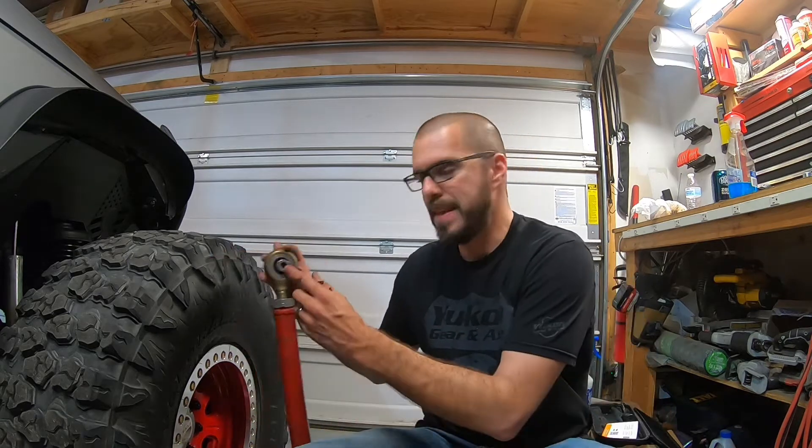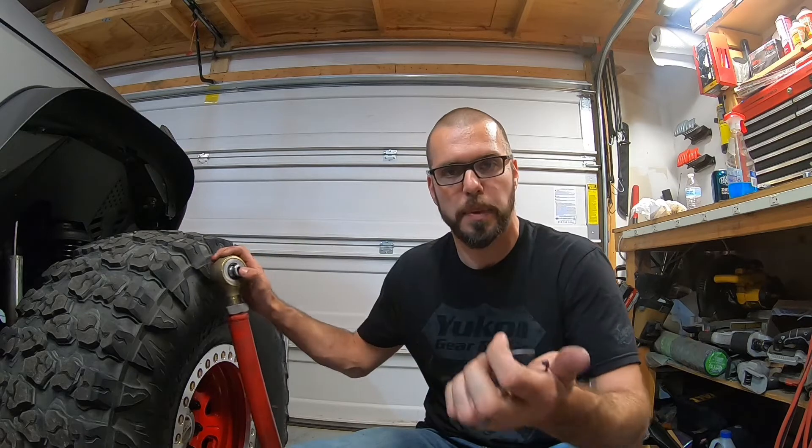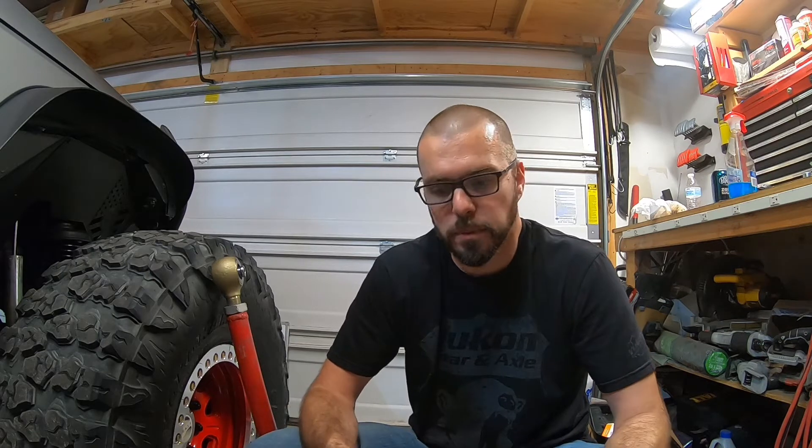It wasn't overly dangerous — it's not like my suspension was going to completely come apart because I still had that bolt through it holding it in the bracket, which was still strong and still torqued. I assumed that joint maybe wasn't put together correctly from the factory because it is completely reliant on this little spring C-clip. I've never had any problem with that before, and there's a machined flange in the end of this that actually locks that little C-clip in there. I put it back together, put it back in the Jeep, put another 1,500 miles on it — it was fine. A couple more off-roading trips — fine. But this past weekend, I flexed it out and heard the pop and had the floating front axle again, with the same joint on the same arm on the axle side coming apart.